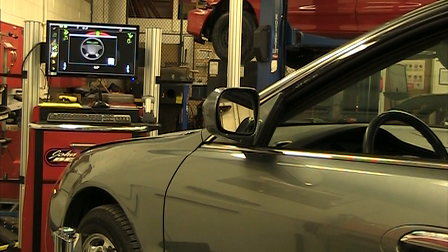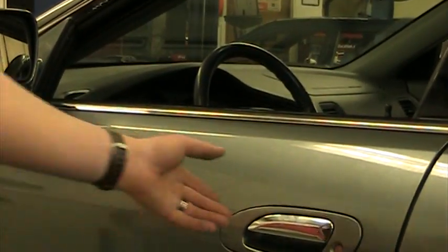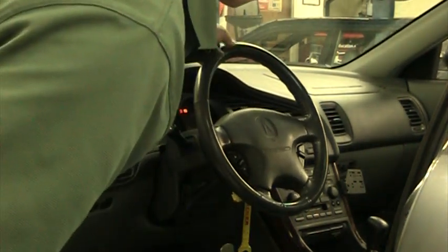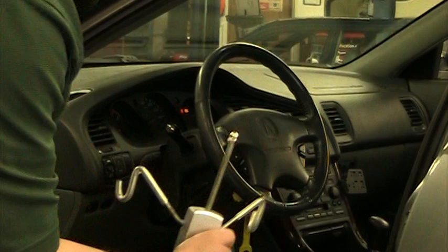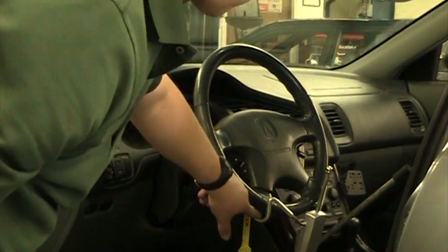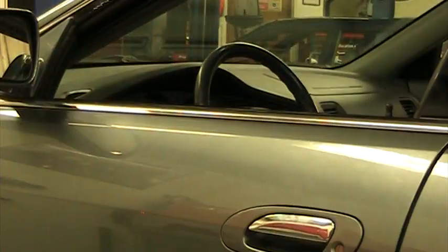This is the most important step — the steering wheel has to be perfectly level. If it's at all crooked and you don't correct it now, your wheels will be pointed straight but your steering wheel will be crooked. Get it perfectly level and put on the steering wheel lock: the bottom wedge goes against the seat and the top wedge against the steering wheel. Put the car back in park and take off the brake depressor so you're not draining the battery with the brake lights on. Wedge the lock in place so it's held against the steering wheel and the seat — the steering wheel is perfectly straight. Close the door.